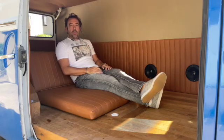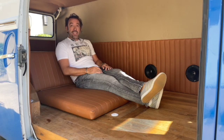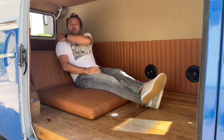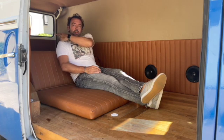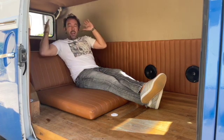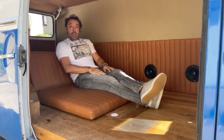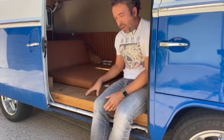So this Tesla battery pack — what is it exactly? It is a 37 kilowatt-hour battery pack consisting of seven Tesla Model S batteries. Usually you would see them right here behind me in a lot of these electric conversions — they put a big old battery box up high blocking the loading area. So where's the battery pack on this van? Well, I'm sitting on it.